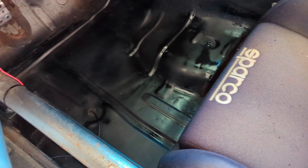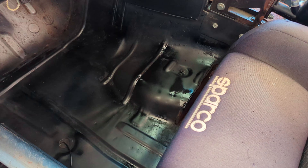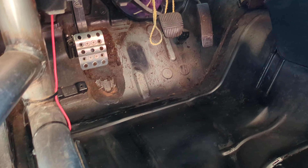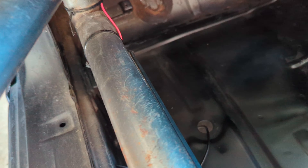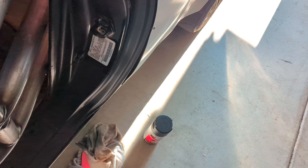Still drying obviously — I literally just finished. I'm also doing my Excursion which is the tow rig, if you follow my Instagram you've seen it. I'm gonna let that dry and probably do up there as well just for rust prevention — make sure all the seams are good. This is rust reformer — I'm sanding it off as best I can, and for spots back there I'll wire brush it, get it down to metal, then use rust reformer as the base.